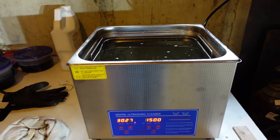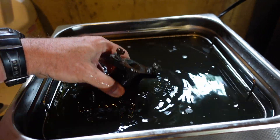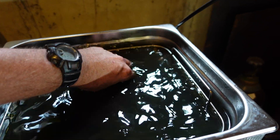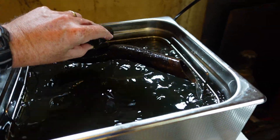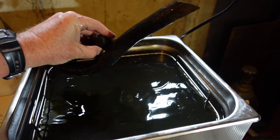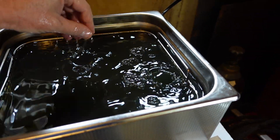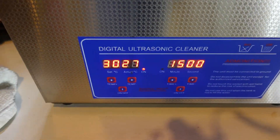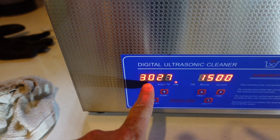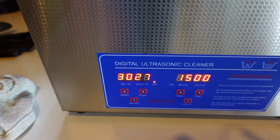What you see here is my ultrasonic sink — you guys have seen this before. What I've got inside here is the distributor pedestal, a pretty beefy piece of metal, and also the breather tube for the motor. There's no PCV valve or anything on this motor — they just exhausted the crankcase fumes right to the road. They're relatively dirty. The ultrasonic sink is heating up; it's set to 30 degrees Celsius, currently at 27, and the blinking shows that it's heating.